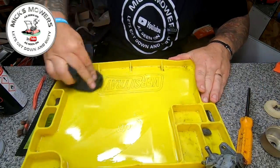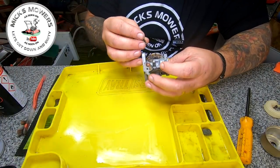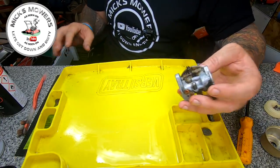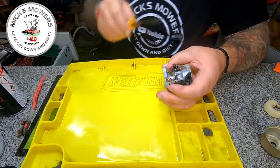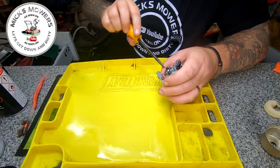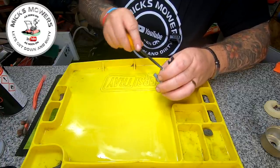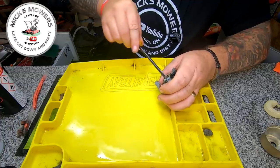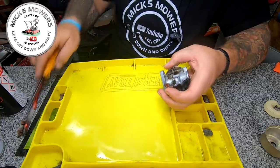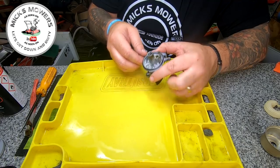Clean your tray off first. The first one to put in will be your little tiny fuel-mixing adjuster screw, which went in there — we wanted one and three quarter turns. All the way in until it's well seated, then back out: there's your quarter, there's your half, there's your other half, there's your one. And that's where it was set before — we may have to come back and redo it, but we'll see how we get on.